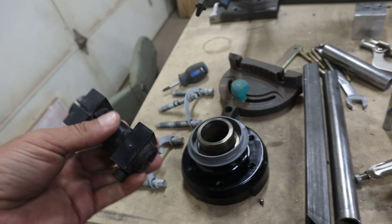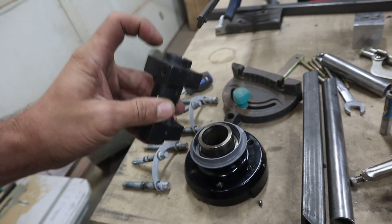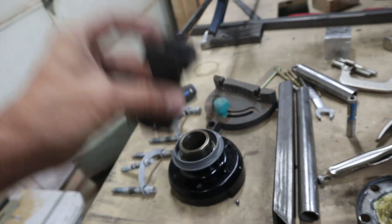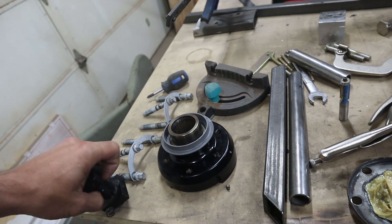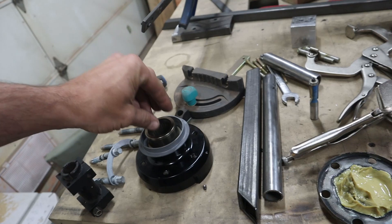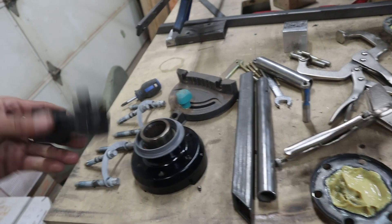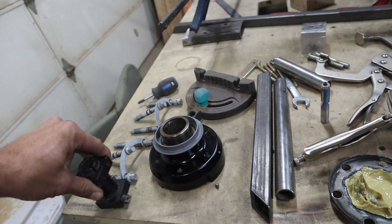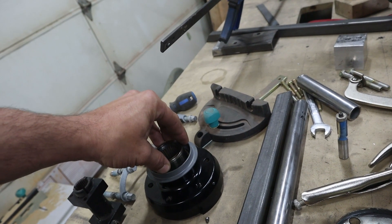On this side I'm actually going to have to double-sleeve this one because it's too big. This is the adapter that goes onto the splines of the transmission. Once I cut that and cut this piece off, it needs to slide into a sleeve, so I'll sleeve the inside of here, weld it all up, press that in, weld that all up, and that'll be good. I'm also going to do a bearing on the outside of this one to support the weight of the shaft, because it's such a small shaft and I definitely don't want it flexing around too much.